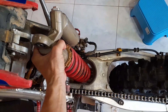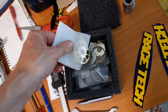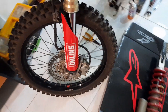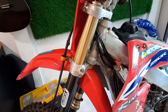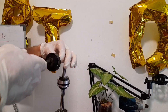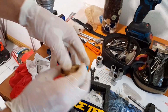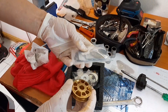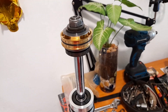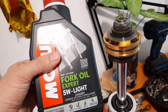Now it's time for the rear suspension. We got the subframe and seat off — we're gonna clean this up and disassemble it. Over here we have the shock gold valves and shims; there are a lot of shims. The forks already have Racetech suspension installed. Now it's time to take off the shock valve stack, and then we're going to assemble the new gold valve from Racetech with a new shim stack, checking our digital spreadsheet for which shims to use. We got the new valve stack and gold valve installed on the rear shock, and we're gonna put it all back together with fresh suspension oil.